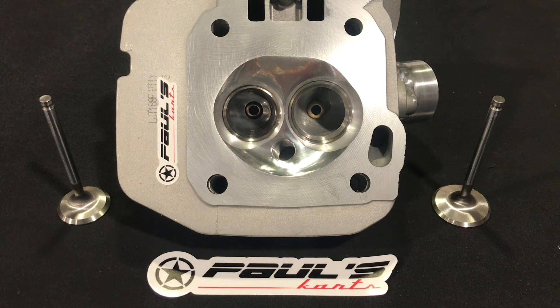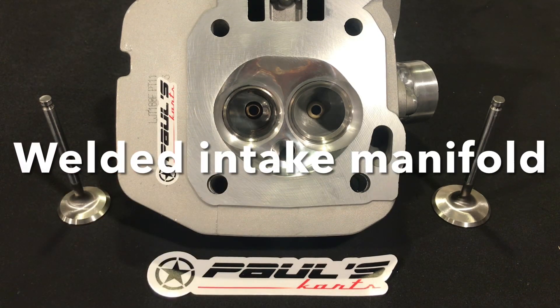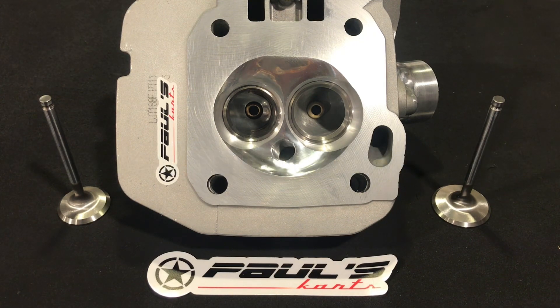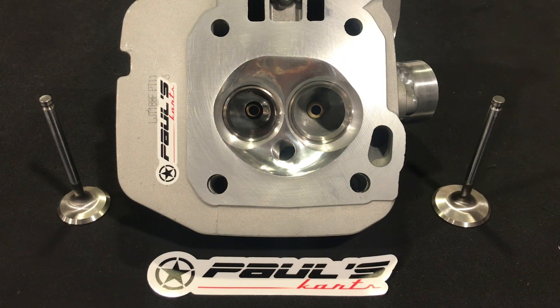So I got this big valve head here for Charles — 38/34, welded intake tube. The welded intake tube on the big block is great just for port design and port shape. You can really get a lot of velocity through the port. With the welded intake tube — and that goes for small block and big block — not having to deal with the confines of the bolt pattern on a manifold really allows you to open up the port and get the velocity and CFM requirements for that engine a lot easier.